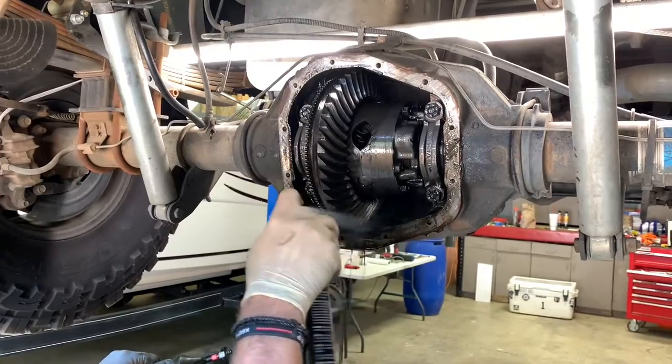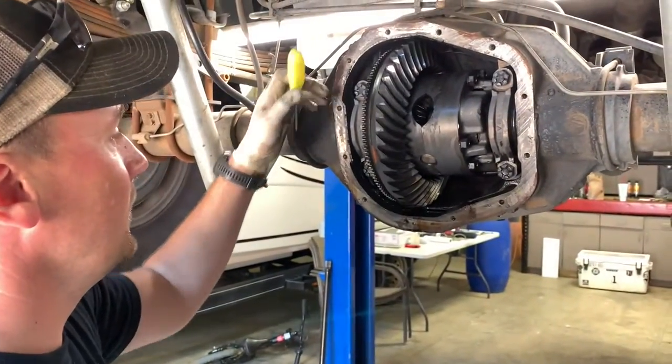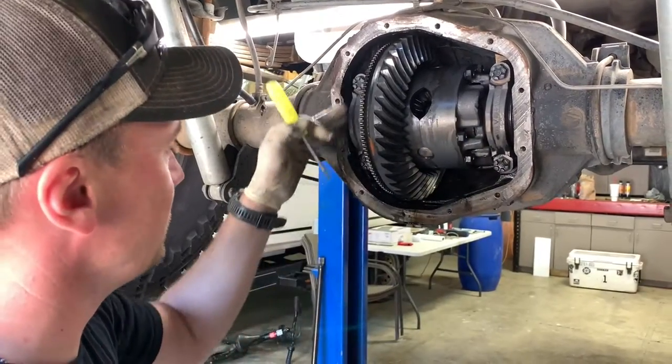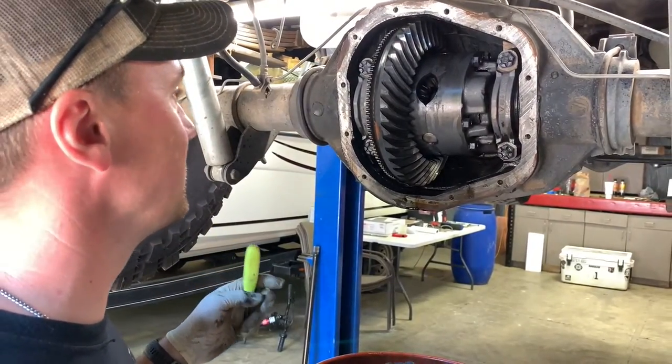Yeah. I think that's probably about free enough for getting it apart. We'll do it more. All right, so doesn't everybody do this, but these are made from the factory. They've worn in certain spots with this rear end, so I like to index them for the top and the left and the right to make sure that they go back in the exact same spots they were in.